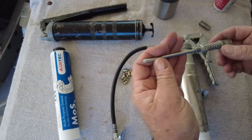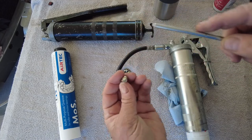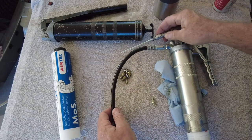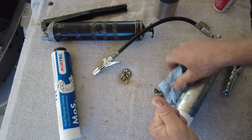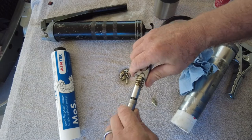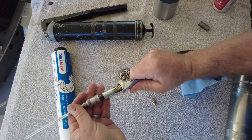There's only one other device I'll show you. On the John Deere tractor the universal joints that go for the drive shaft are hard to get to. This tip allows grease to come out — the idea is that you push this right up to where the ball bearing is and square it, so you can eject the grease a long ways. Like if you had some tight place you couldn't get your hands to. It just has a little grease fitting in the end, so you'd simply just click this to it, and now you can get grease to someplace that's really out of the way and hard to get to, so you don't have to remove stuff. When you're done, you just pull the handle and pop it off.